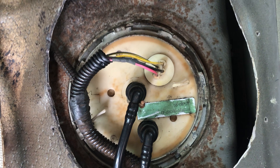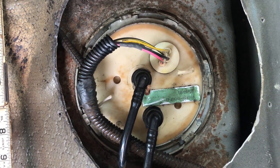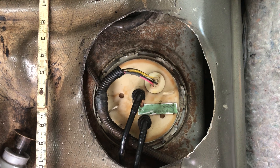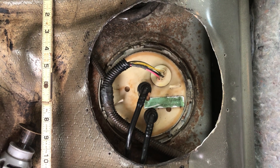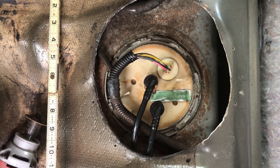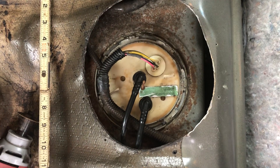The yellow plastic piece — the canister — is basically five and a quarter inches in diameter. The eight-inch hole ended up a little too big for what I needed. I would recommend a seven-inch hole. If you're really good you could probably do a six-inch hole, since the canister diameter is five and a quarter inches, but you have to cock it sideways when you take it out because of the filter material that sticks off to the side. I really wouldn't go any smaller than a seven-inch diameter hole.